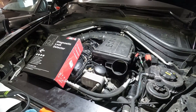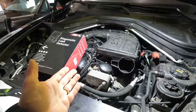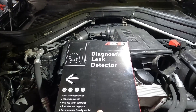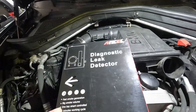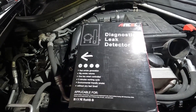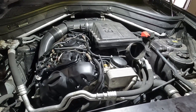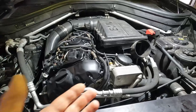Roger here from Ask the Car Expert YouTube channel. Today I'm going to be smoke testing a BMW N55 engine. I'm not associated with Ancel, but this is a tool I really like — the S3000 diagnostic leak detector from Ancel. It's made in China but does a great job and does not require an external compressor. If you have a mixture-too-lean fault, did some big repairs, or are trying to figure out if you have an unmetered air leak causing rough running or high fuel consumption, you're going to want to smoke test your engine.